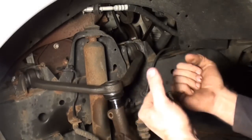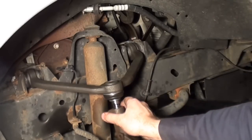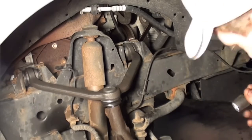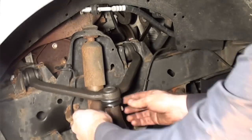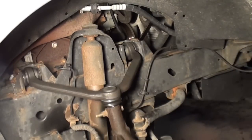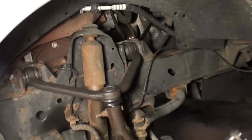I just used the spindle to help me center that ball joint. We're going to knock the ball joint down until that notch is lined up — that's where the through bolt goes. When you clamp it down, it actually has a clamping force because of that notch. I just straightened the wheel back out. Take a peek through and push it down until it lines up, then push your retainer bolt through and tighten everything back up. I'll run it down with the impact, then tighten it with the ratchet. Now you can torque it to spec.